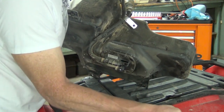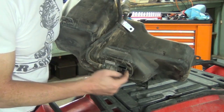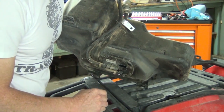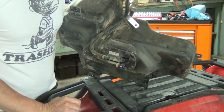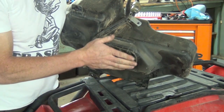As this is plugged in, the very far right-hand side is the ground, and then the next one going this way from that far side is the power wire. So if you were to run power and ground to this, it should come on and run. I did that and it didn't run, so I know that the fuel pump's bad.